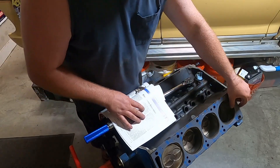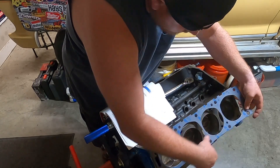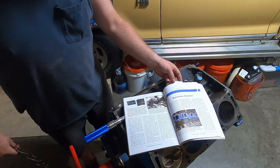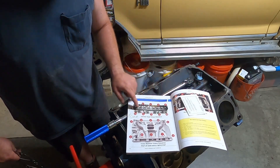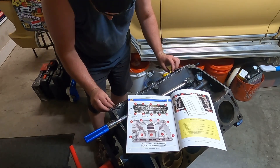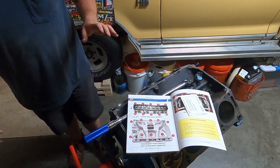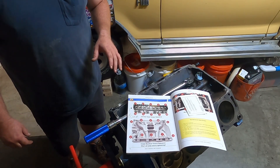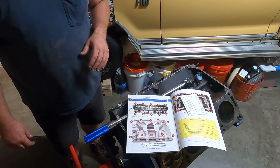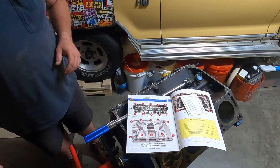They will be opposite colors from each other if you go with this kit. I'm going to go with 95 foot-pounds, and this right here is a torque sequence. Everything's clean — block side, head side. I've got the bolts wire-brush cleaned out; they've got just a little bit of oil on them, not a whole lot. They're factory bolts, not ARP or anything. This is just a bone stock motor just to get this old truck back on the road.